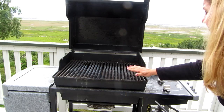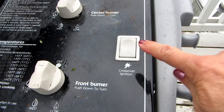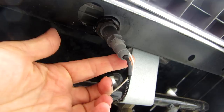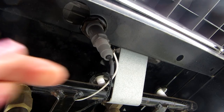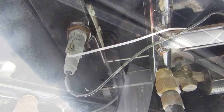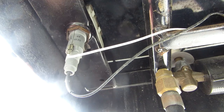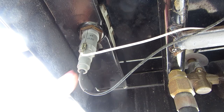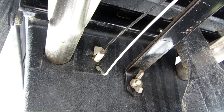So I know that my burner is lit. Look up under your tank where the igniter is — it's a bit awkward — and you'll see there's a black wire and a white wire. What I discovered was my white wire had come loose, so all I needed to do was push it back up and my igniter worked. I didn't have anything seriously wrong — just the wire came loose. This connector just slides off and on, and that had come loose. So if you're having trouble with your igniter, look for these wires and see if they're connected. Check the other end of the wires too, and make sure they're both connected to the igniter that's inside next to the gas line.